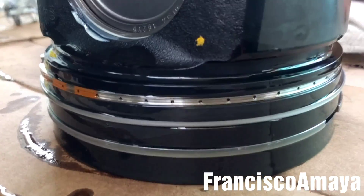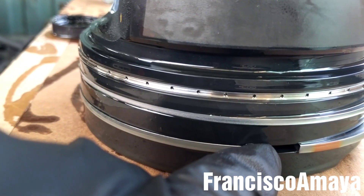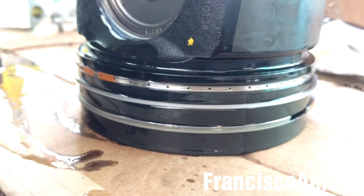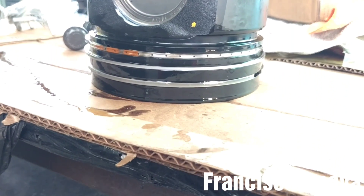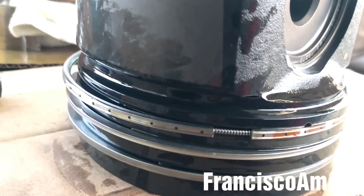I have the oil applied to the rings' distribution. Remember: this is zero degrees, this one 120 degrees — so 120 degrees on all of them. Make sure to double-check that multiple times. You don't want to make mistakes; if you don't do it right there will be problems with the power and oil consumption of the engine. So pretty much 180 and 120 — something similar to that. There is tolerance where it can just be okay.